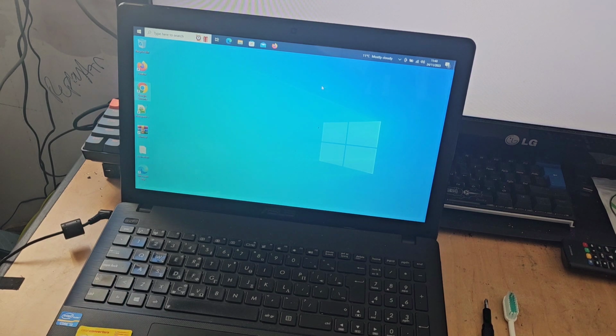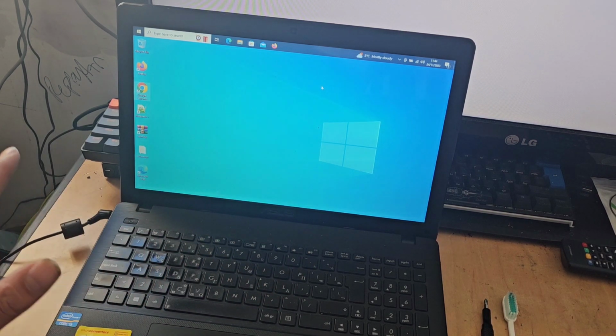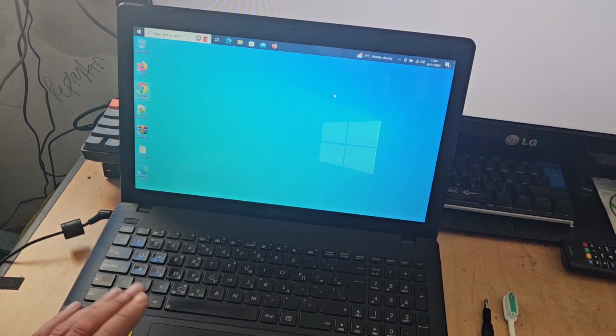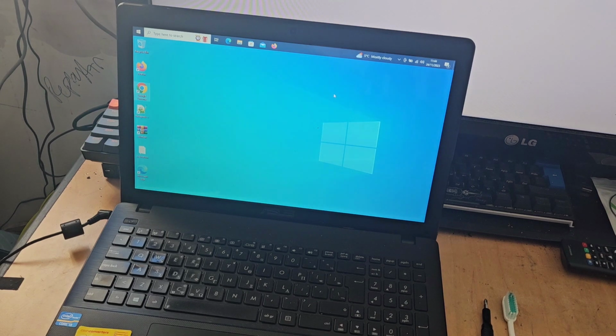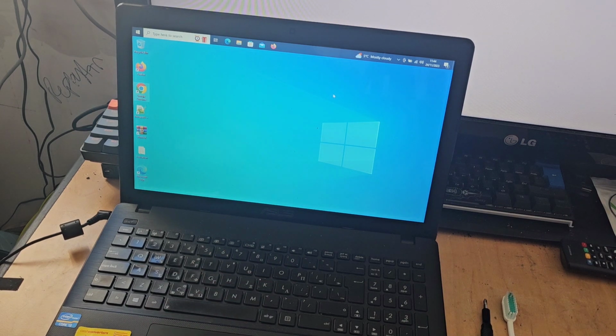just simply an upgrade, well, it wouldn't really be good enough, because at the end of the day, if the customer wasn't complaining about the machine before, when they had it, we've gone through all of the other processes, such as checking file system, making sure there's no malware, making sure there's no rootkits or tools, and that the file system itself and Windows is all right, then there shouldn't really be any need to add the additional RAM, because it was running fine before. So already we can see by this that it is the hard drive that's on its way.